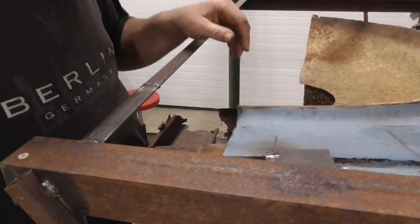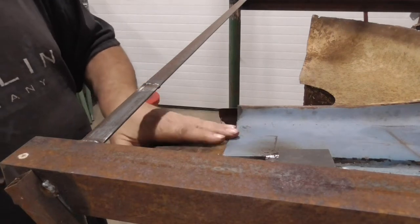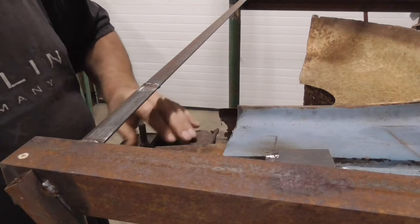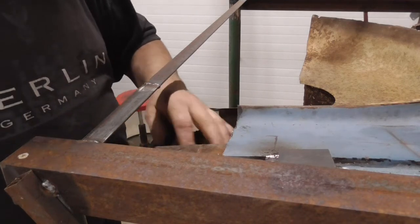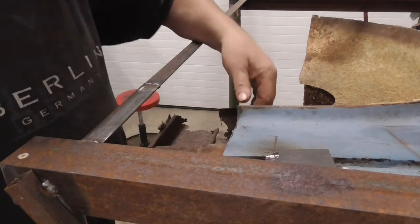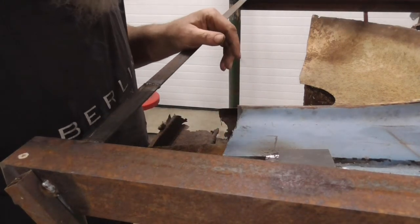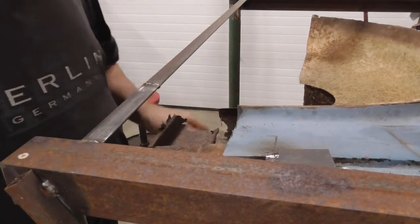You know, this piece here I'll put on last, after I put the new lower, after the body goes on, because I don't know exactly where all this is going to go, and I got to weld this B pillar to the inner rocker, and I can't do it with this piece on. So this one will have to stay off till towards the end. So the three pieces of body come together. More later.